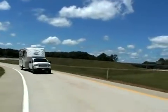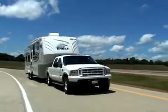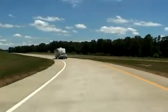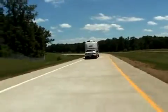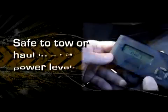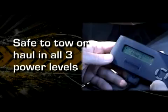The secret to fuel economy is to keep the truck in the higher gears as much as possible. With Hypertech power tuning, you will accelerate more quickly up to cruising speeds, spending less time at higher RPM in lower gears. Your truck will maintain cruising speeds up hills to avoid downshifting to lower, higher fuel consumption gears and to avoid unlocking the torque converter and using more fuel due to slippage. Factors affecting fuel economy are total vehicle weight, traffic conditions, terrain, and driving habits, so we offer three different power levels to allow you to try each one and discover which works best for your circumstances. Only Hypertech develops Stage 3 maximum power level tuning to allow safe towing, so feel free to try every power level. You may be surprised to discover that Stage 3, the most fun level for performance, also delivers the best fuel economy for the most demanding conditions of hills and stop-and-go traffic.